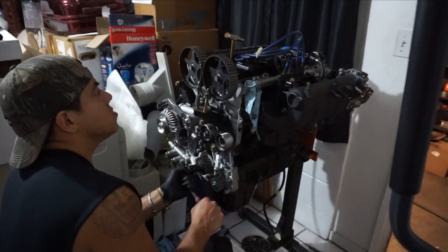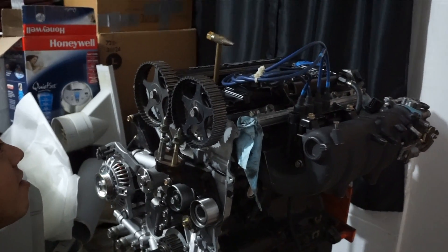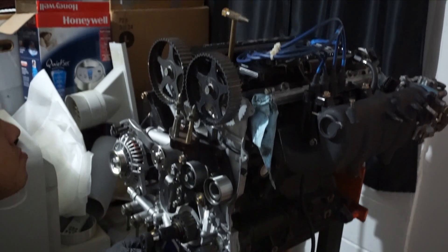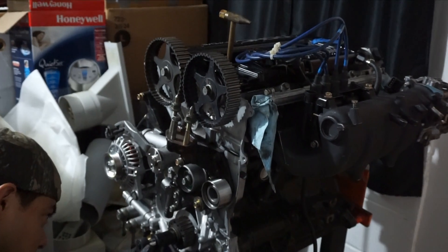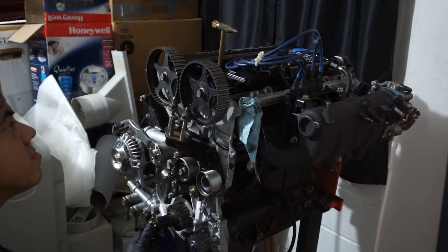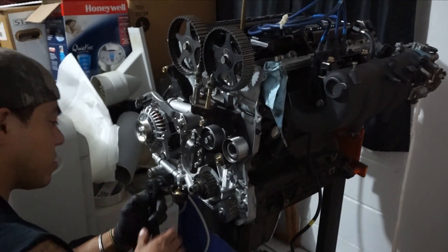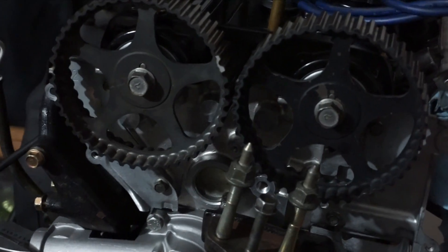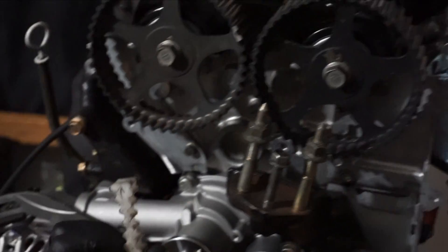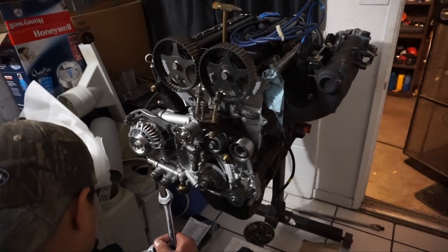Okay, let's try that again. That is pretty much TDC because it's going to start coming back down. So the timing mark lines right up. So we found top dead center. Awesome. And are the cam gears lined up? Cam gears are about to be lined up with this thing. Makes life a whole lot easier. And this is the J Racing timing kit? Yes, sir.